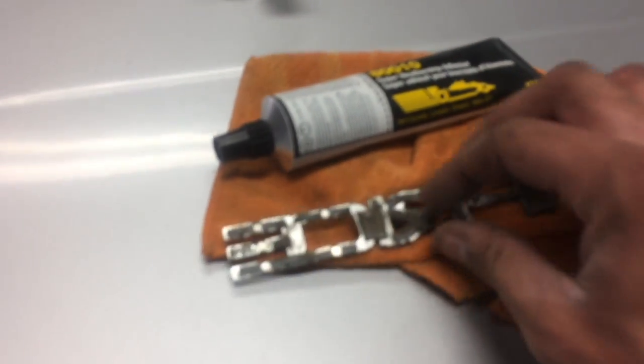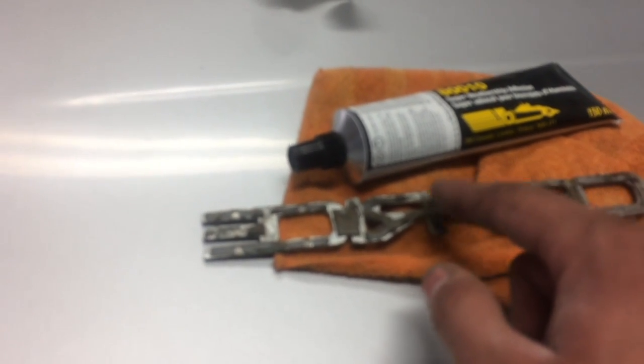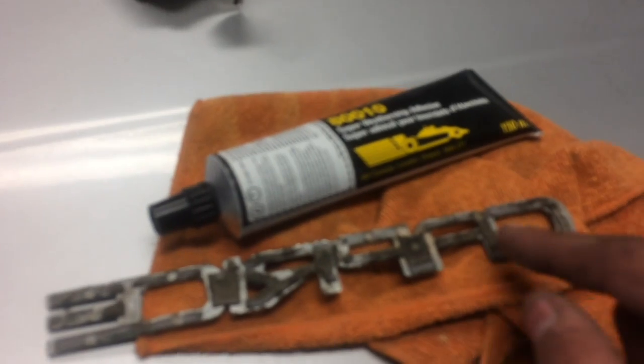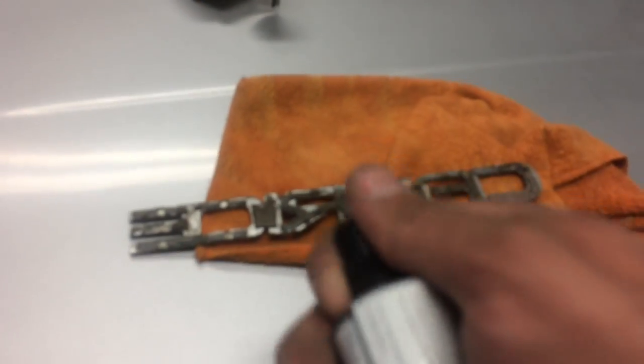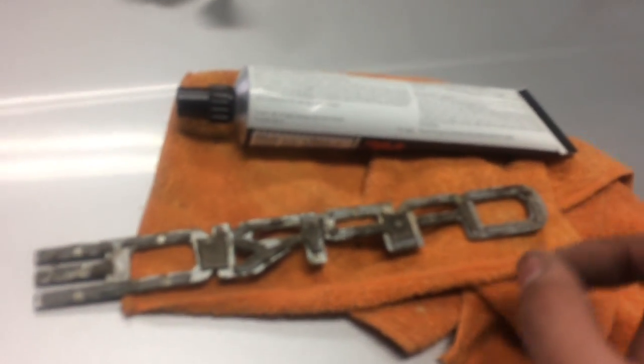But you have to make sure that it is absolutely clean. So even this surface here, we want to make sure we take our wax and grease remover and clean it. Now, if there is loads of guck stuck to it, this isn't so bad. We can actually apply a thin bead right across every letter. I can take this tube, take the cap off and just slowly squeeze out. You want to go slow with this because this nozzle, if I take the tip off, is very wide, so it's going to come out fairly thick. Actually, this nozzle's not bad, but it's still fairly thick compared to a lot of other ones.